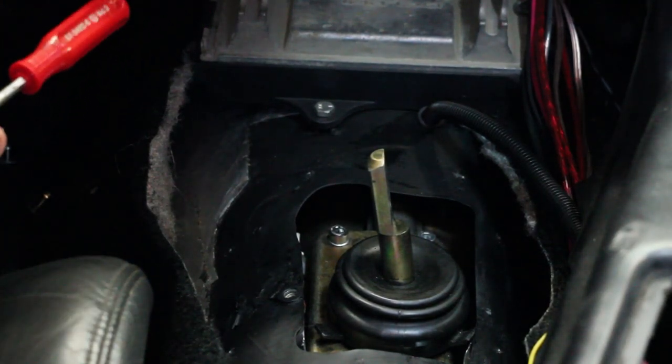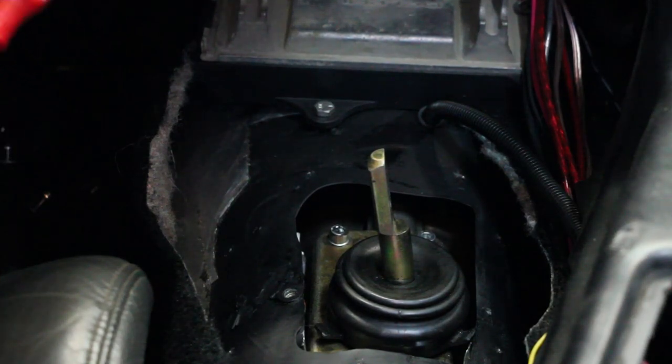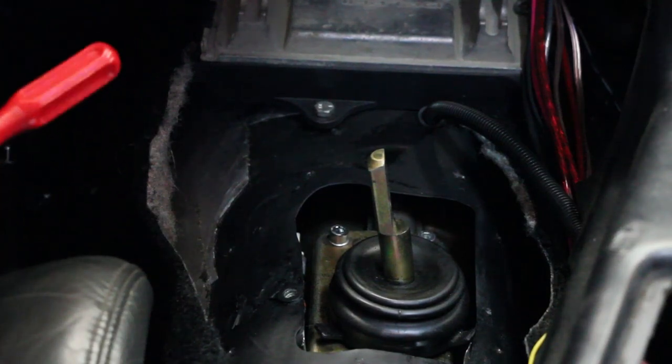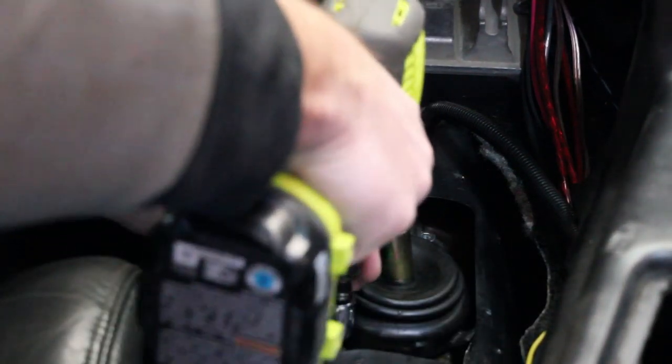Also, the VSS will help you when you're coming down to an idle. It helps control the IAC to tell your car how much airflow it needs or how much speed your car is sensing versus load and all that sort of stuff. So without a VSS, you're gonna stumble and stall when you come to a light. Ask me how I know this. I've been through this. And it looks like 5 millimeters to pull these out.